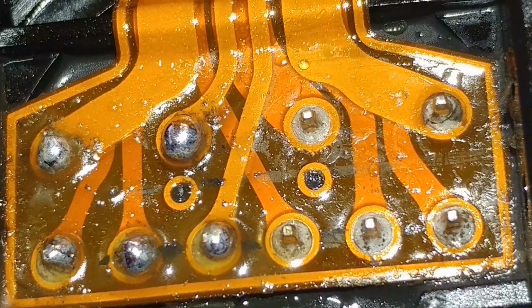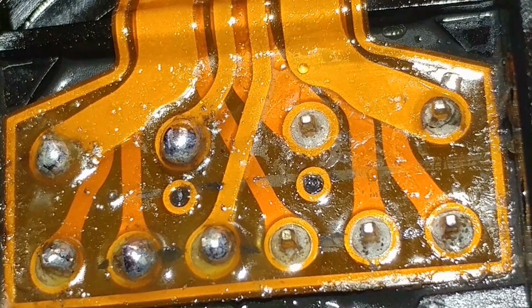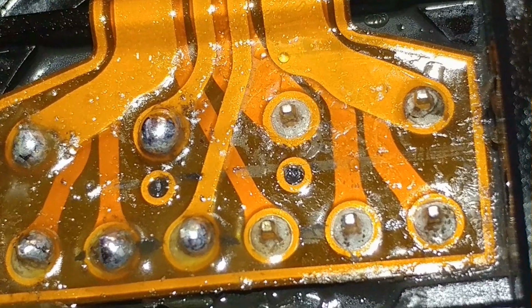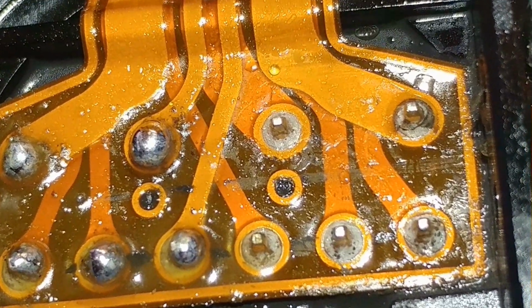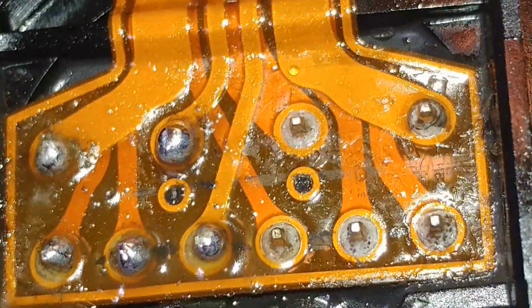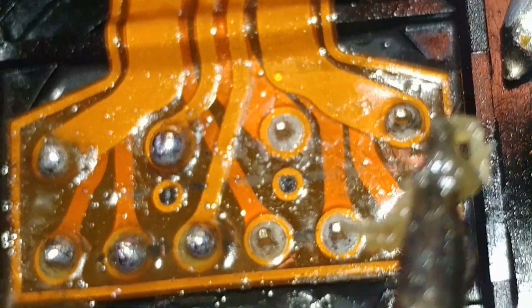It could be a micro crack right there where that solder is. Because think about it, they stick it up there and put like a monolayer of solder around it, so they don't have a little ball on there. Right. Well, let's do them all because they've all been in the same environment. They've all had the same thermal stresses on them. So if one failed, the others can.